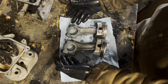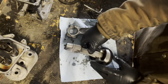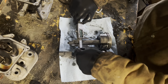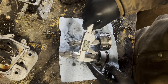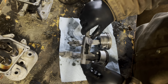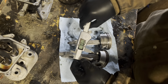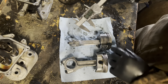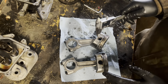The Briggs rod is wider, but in terms of thickness — measuring rod girth: about 7 tenths on the Briggs, and not much more on the Kohler. But I would trust the Kohler rod to hold up to the abuse a lot, lot longer.